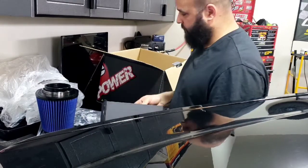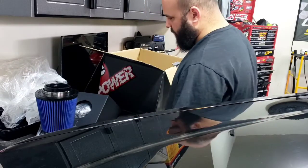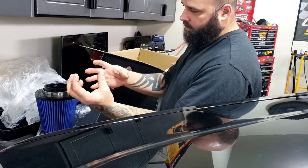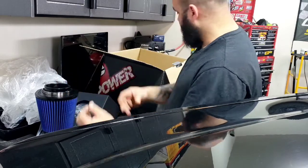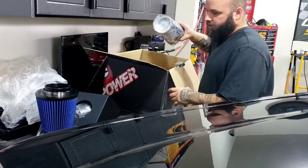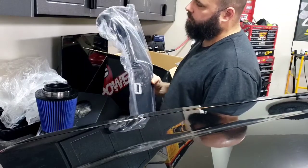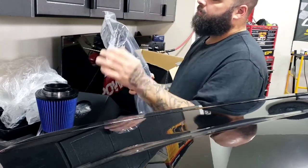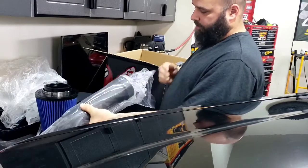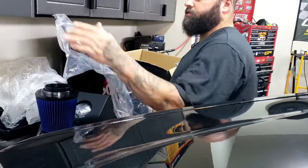I'm going to be taking that box out and opening up the airway coming from the bottom side of the fender, along with the one on the outside of the fender — so I'm just going to modify that to get a bit more air. Then I'll do a data log, because I'm pretty sure this will run it a bit more lean, and with the new exhaust setup going straight through, I just want to make sure all the numbers are good.